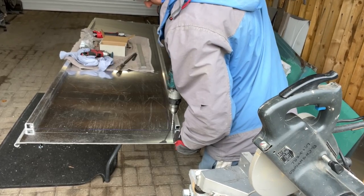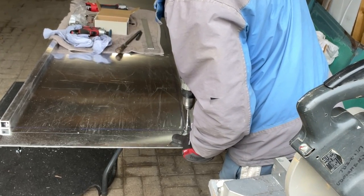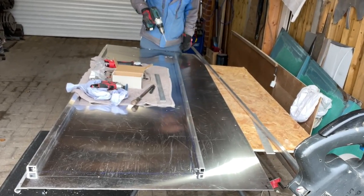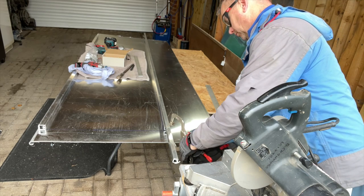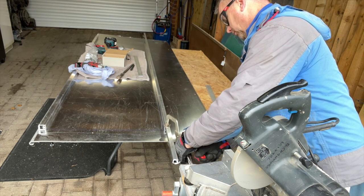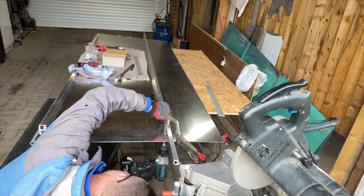Pop some oil through — we'll drill through this plate from the top, then I can hold that box section in place and then drill up from the bottom and get it through into that box section. Make sure it's all nice and level where it needs to be. I'll put another piece over the top to hold it all down so I can get these clamps in at the sides. One either end though and it'll work like a treat.